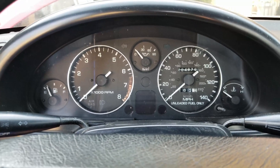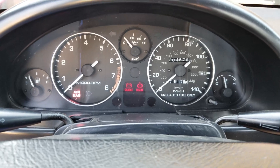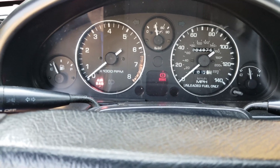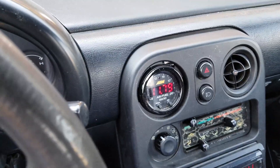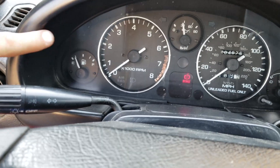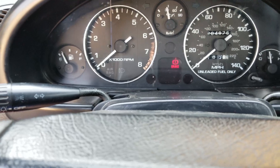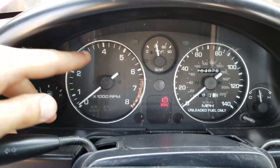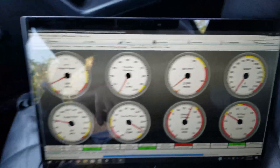I figured I'd record a short clip of what the ITBs sound like cranking over and starting. It starts up pretty smooth and idles around 1000 RPM at around 12 AFRs — takes the AFR sensor a little bit to heat up. You'll notice the tach output is also reading incorrectly. I've messed around with the Speeduino settings to try and half or double that output and haven't gotten it to read correctly, so I'm probably just going to go with a digital dash or write my own code for the tach output specifically. It does read the correct tach output in the actual ECU itself on a laptop.